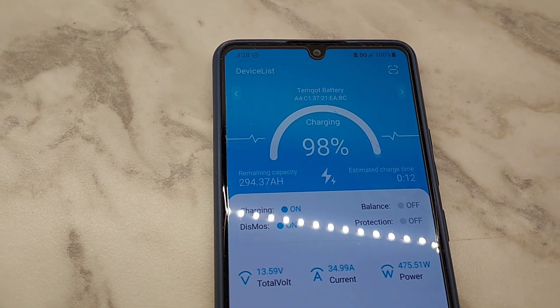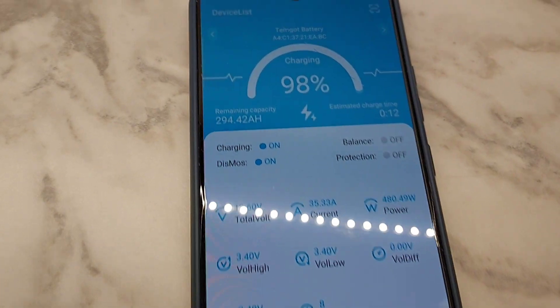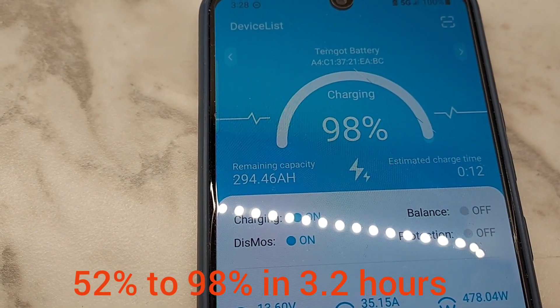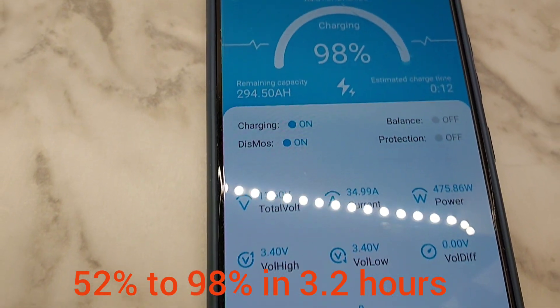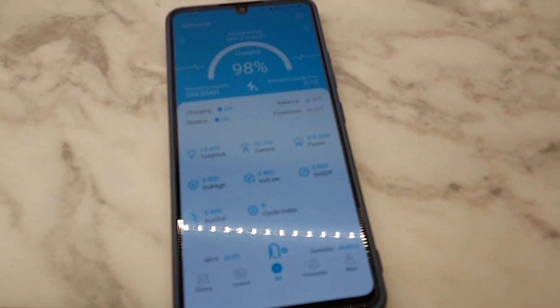It's been three hours and 15 minutes since I started this and the converter is working a lot better. It went from 52 percent to 98 percent in three hours and less than 15 minutes — it's really cranking out the amps, way better than before. It did 55 amps for a long time. It's still not on lithium yet — you can see the green indicator in there, so it has still not switched to lithium mode.